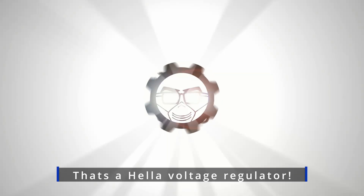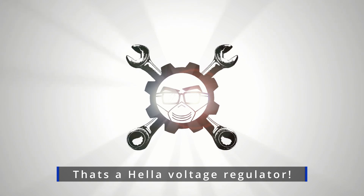Just recently, I had an issue where I was on a longer trip and my voltage dipped down below 12 volts, because I had the AC on, the headlights on, playing the radio, and my voltage dipped down. I was able to tell the voltage was dropping, turned off my accessories, and my voltage hovered at around 11.9 or 12 volts — which is discharging the battery. It should be 12.5 fully charged, and ideally around 14 volts would be fully charging at highway speeds.